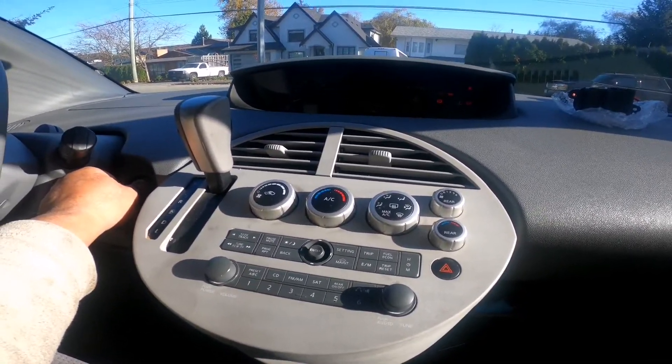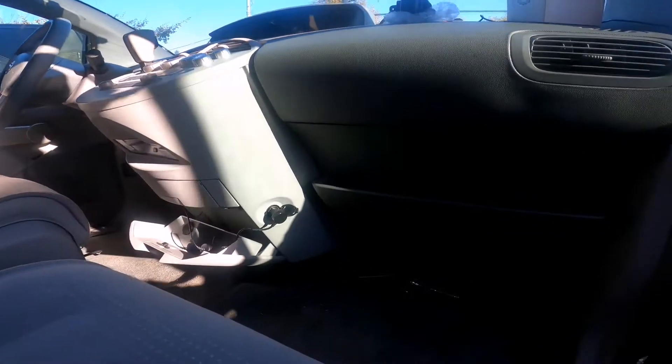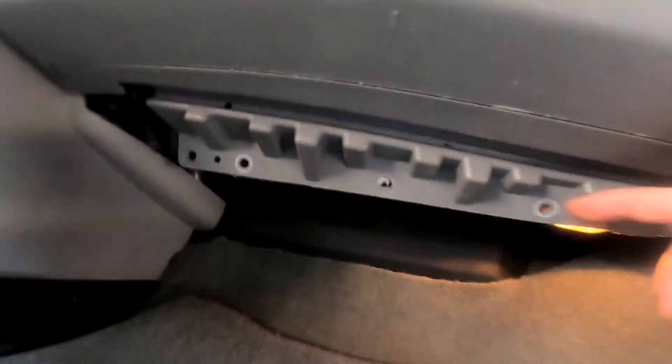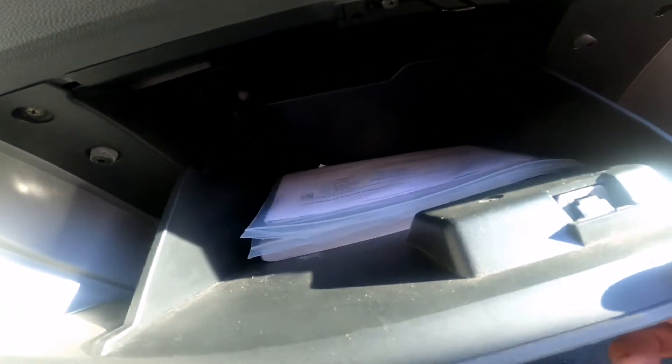So I'm going to do this repair now. The only thing I need is to open the glove compartment box underneath — that's where the blower is located. What I need is a 7mm socket and a Phillips screwdriver. This has a 7mm bolt and there's also a Phillips screw to remove. I've already removed that one, and once you open the glove box there's more to open.